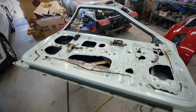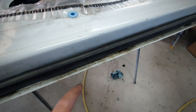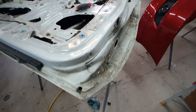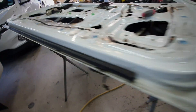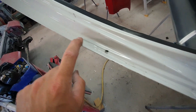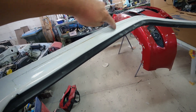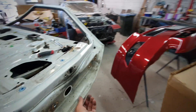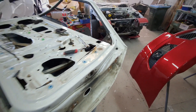Into the next door now — all very much the same as the last door. There's another rubber seal and you can see a bit of rust coming all the way through, the rusty stain. So it's going to be exactly the same — peel this bottom piece apart. It's not too bad through here. I actually think this door might have been painted before because it's quite white inside those areas. Looking through here is cracked paint in the sealer, like it's been painted over — not factory. There's a bit of rust staining coming through there, and there's no sealer through that area, which normally would be through there. It'll be interesting to see what comes of this door. I think there is some filler on the edge here because it appears to look a lot thicker than the other side. We'll block it down and see what appears.